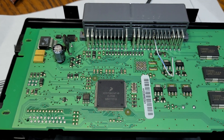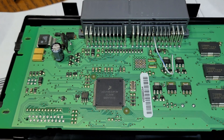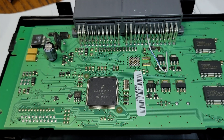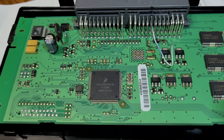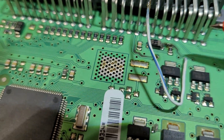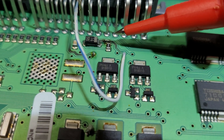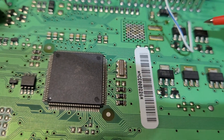I could tell the air conditioning was working because the lines would get cold on one side and hot on the other. But when you grab the heater core lines, it was pumping hot water in even though I had replaced it. I went to the climate control module and when I really analyzed it, I found a burnt tracing right here — you can see it's all black.